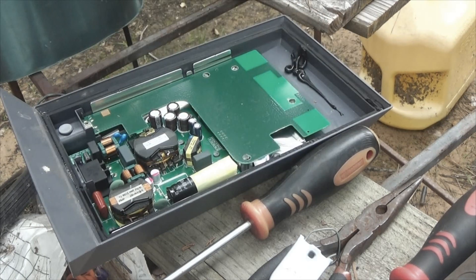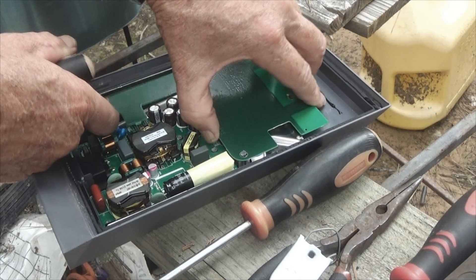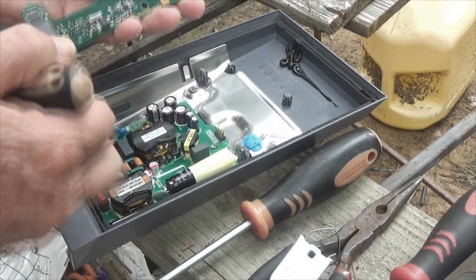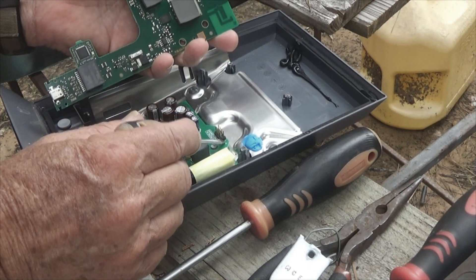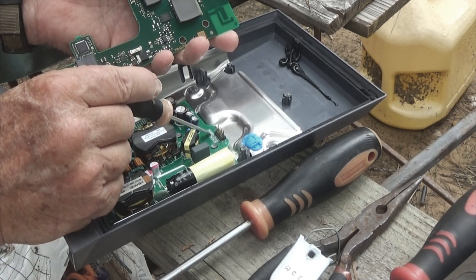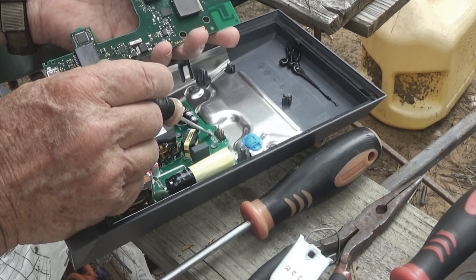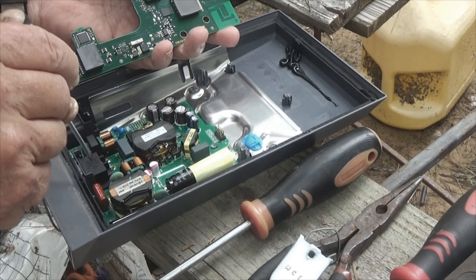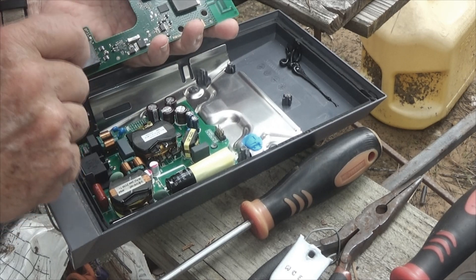With this plastic off here, this piece can lift straight up, just like that. The connection between this plate and the power is fed through these pins right here. The top row: the first of these four is earth and ground, then 12 volts, then white LED. And I'm thinking the white LED is right here.